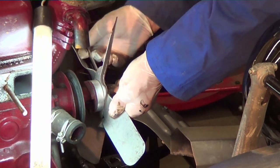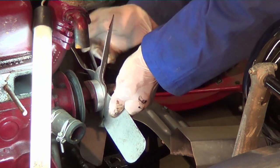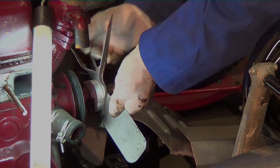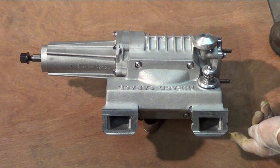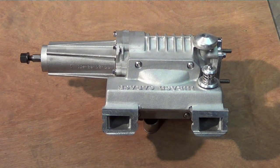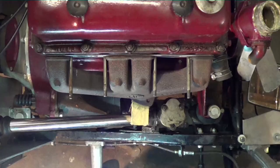Next we install the spacer that needs to go behind the fan. The fan blade would touch the new belt on the supercharger drive, hence the spacer. Now, we've got the new manifold gasket fitted and slid the cleaned-up inlet manifold back on. One problem: on the bottom corners of the supercharger, the instructions say to slide it on the studs up to the block — that is not easy. I actually had to take a tiny little bit off the bottom of those two corners to make it slide on.